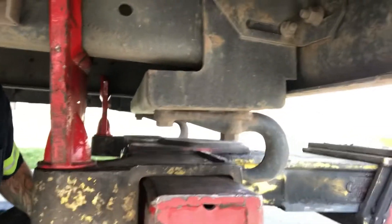I've got my medium forks on and I went with medium for a reason. A lot of people say you hit your hooks — yes, you do. I got the hooks right up against the backside of the underreach, and I got it like that for a reason. We're going to leave it there — that's going to give us a stop point to sit up against for chaining, and it's going to help ensure that our safety chains stay in the hole. We've got the forks all the way up against the frame rail. We're not loading those hooks — we're just putting it up against it as kind of a block.